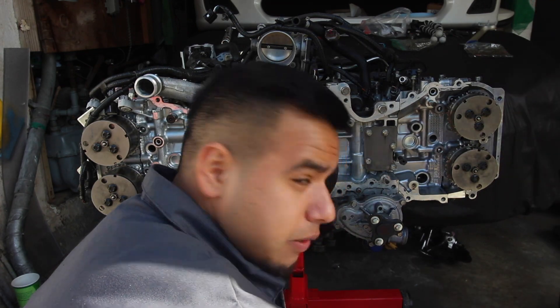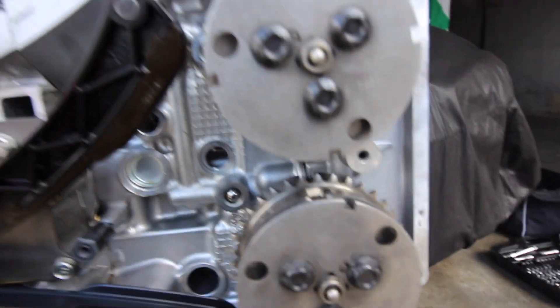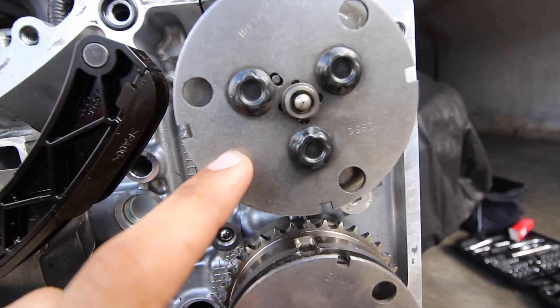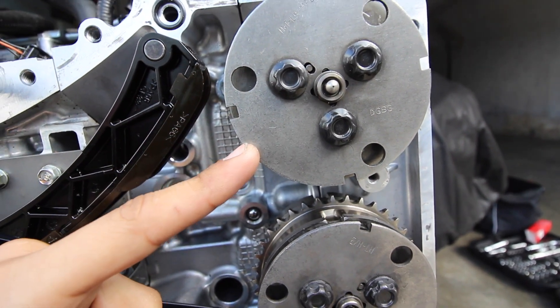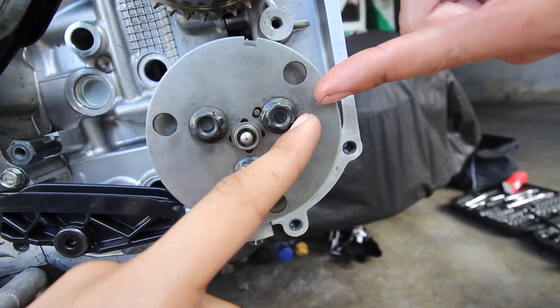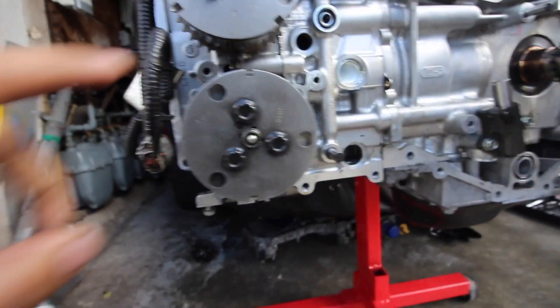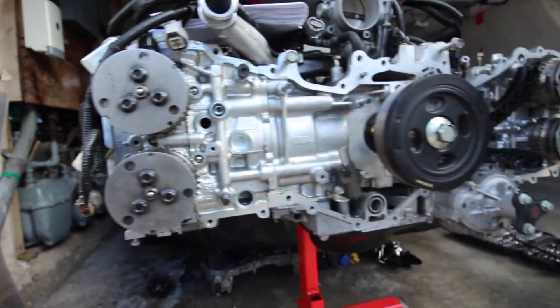You know we're recording, Eric. So to set timing, there's a little arrow right here. It's supposed to be here and then 25 degrees down like that. And this one is supposed to be straight up, 25 degrees right there. And then this side — these two are supposed to be facing each other. And then you can set timing.